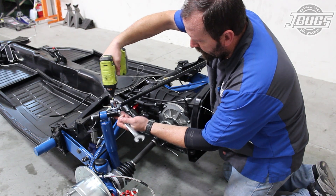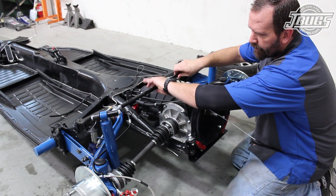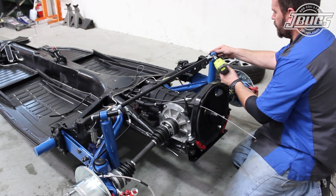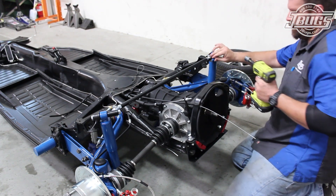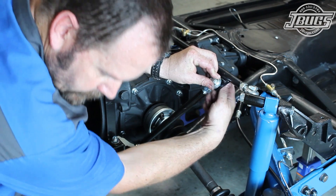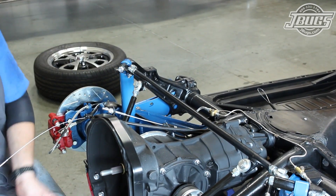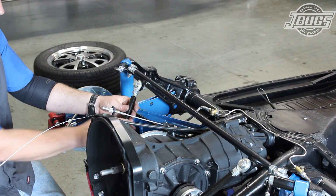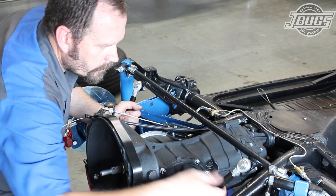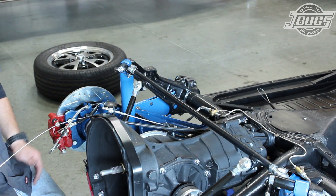The end link bolts are tightened down. Then the cross bar is adjusted so that the end links are pulled in towards the center of the car and the tabs in the cross bar are pointed towards the frame horns. Then the upper shock bolts and the jam nuts for the heims are tightened down. Both the vertical supports have left and right hand heims like the cross bar. They are bolted in place to the tabs at either frame horn and at the cross bar. The bolts are tightened and then the supports are adjusted. The left side support is shortened until we feel resistance and the right side is lengthened until we feel resistance, and all the jam nuts are tightened. Adjusting the supports this way helps to counteract the torque that the engine puts on the chassis and helps prevent chassis flex at the frame horns and shock towers.